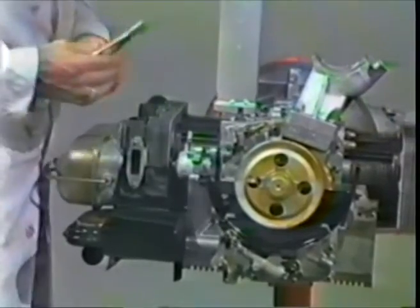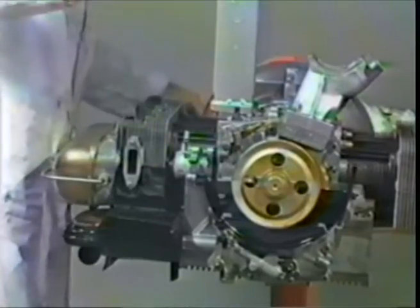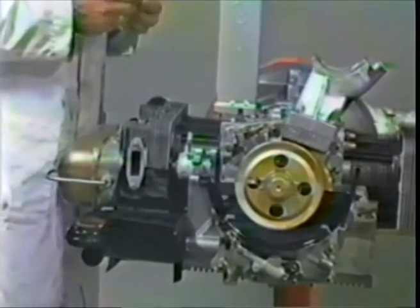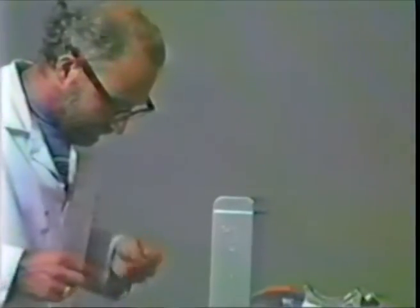Now occasionally we'll have to do a little bit of maneuvering here to get this bolt hole to line up, but that's easily done. Then get out 12 millimeter across the flat nuts. That's the right ones to use on the heater system. That way you can get it off again pretty easily. Pick two nice ones, put the nicest one on the top, manufacturer's logo to the outside.